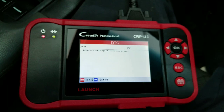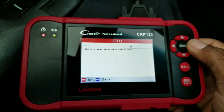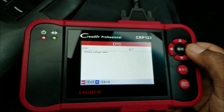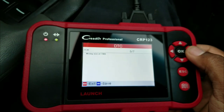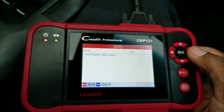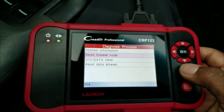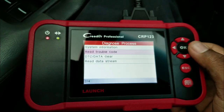We have seven codes for the ABS system. We have one for the right front wheel speed sensor — that's the passenger side — left front pulsar failure, battery voltage failure, brake switch failure, wrong size tire meaning a wrong size sensor, logic failure, and internal power source failure. I think some of these codes are old; the only real pending code is the wheel speed sensor on the passenger side.